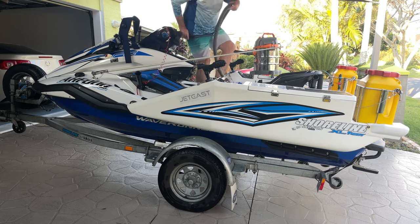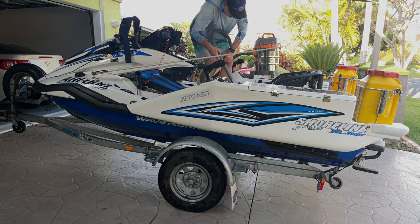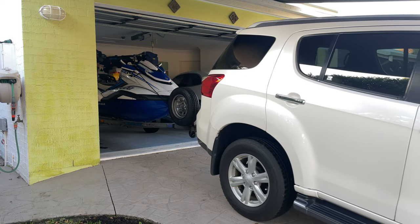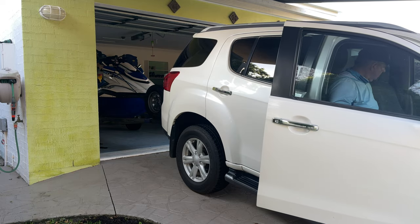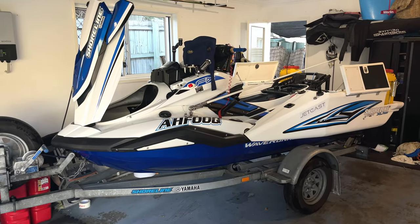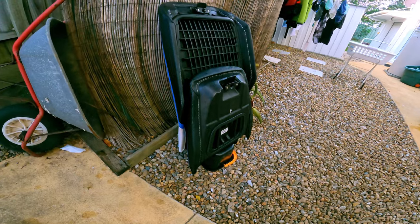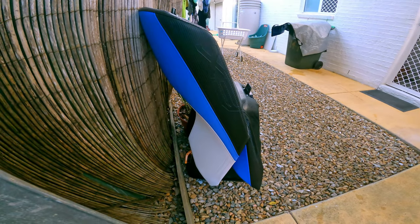The hull will always have some water in it even after rinsing and draining, so I use a cheap wet-dry vacuum to remove as much water from the hull as possible. To keep my ski in top condition I always store it in the shade — I have a garage, but if you don't, consider renting a storage shed or getting a good cover. The problem with covers is the ski needs to be very dry first, otherwise it becomes a greenhouse and the ski can deteriorate quickly with mold building up on the seats. I store mine with everything open: seats off, front hatch, glove box, and tubby hatch all open. Seats are dried in the shade on their ends, using a flat bucket as a platform to protect the corners.